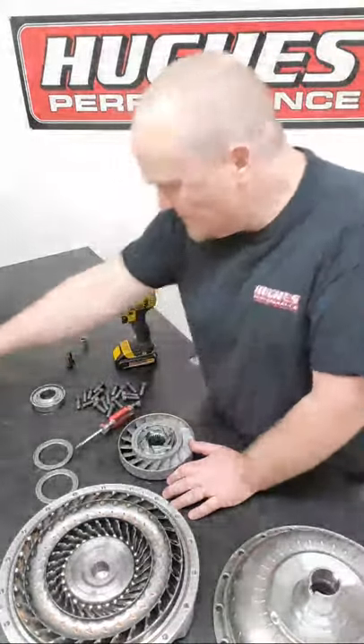Make sure the snap ring is fully seated in the groove so it doesn't come flying out when the converter is running - otherwise that's going to make metal and ruin your converter. Stator cap back in, bearing goes back on - it's just a light press fit. Removable stator cap side of the stator faces up towards the transmission side of the converter. Set the stator back in place. Make sure your o-ring remained in place - if not, use some trans gel or petroleum jelly to hold it in place - then drop the pump back on over your dowel pins.